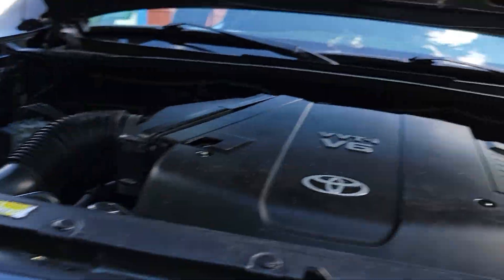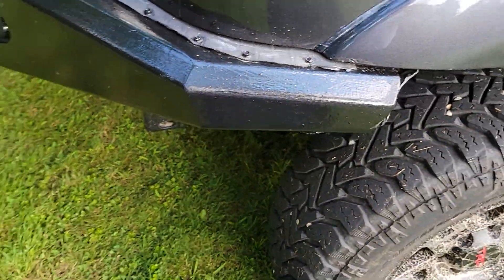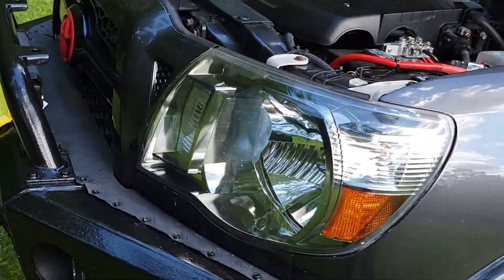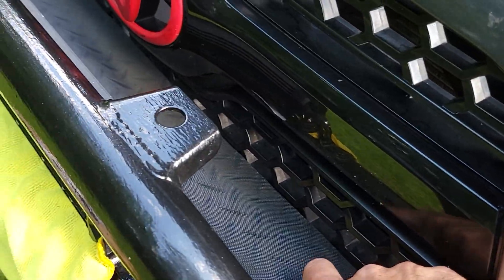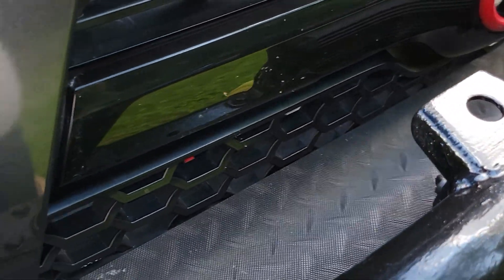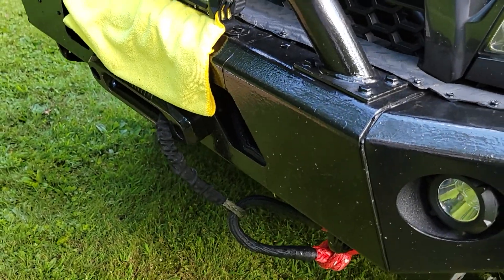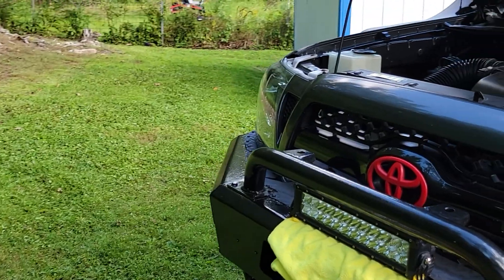If you're a Tacoma owner with a DV8 bumper, you've got this funny-looking piece of rubber right here — that's a make-it-last engineering solution: self-tapping screws painted black, using rubber mat material I think I found at Home Depot — something like a running or footboard mat. It prevents snow from falling down inside the bumper and getting where the winch is. There's a little DIY tip for anyone putting a Harbor Freight winch in a Tacoma or any four-wheel-drive vehicle.